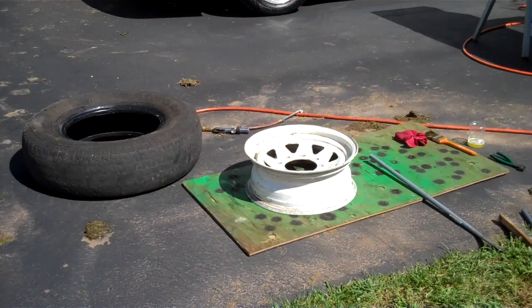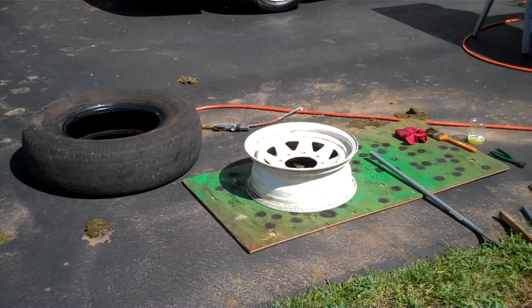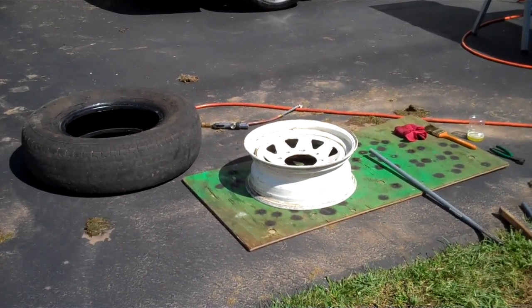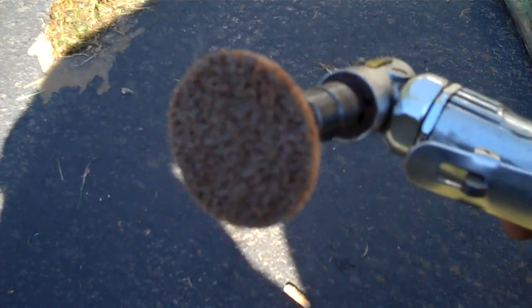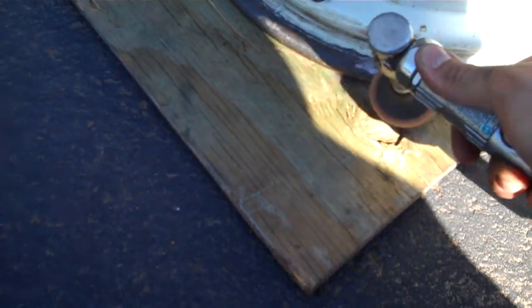Same thing with the new tire — just put some lube around it and push it on. I'm going to replace the valve stems too; it's a good idea while you've got the rim off. Otherwise later on you've got to break one side down just to get to the valve stems. This rim is a little funky so I'm going to hit it with a right angle die grinder with a sanding cookie on it to clean it up.